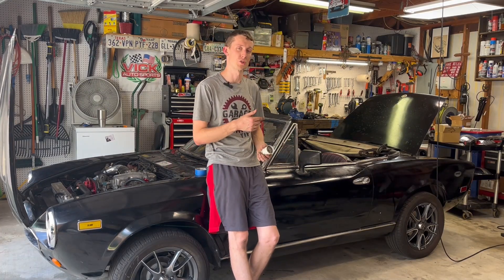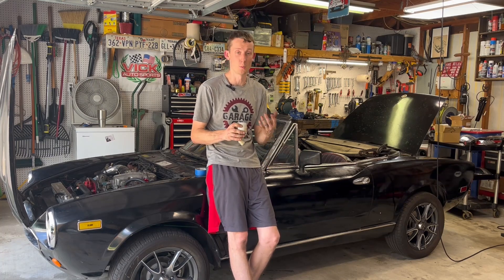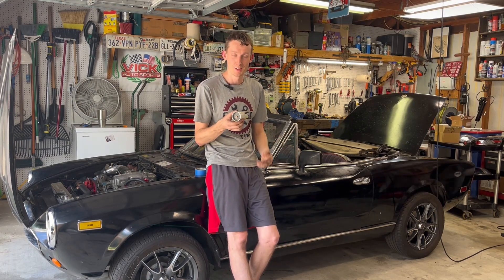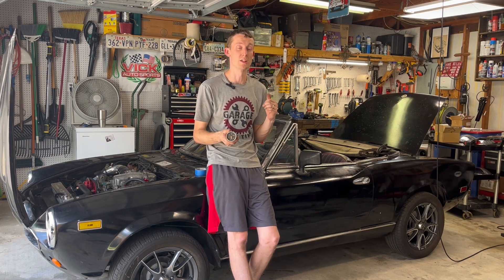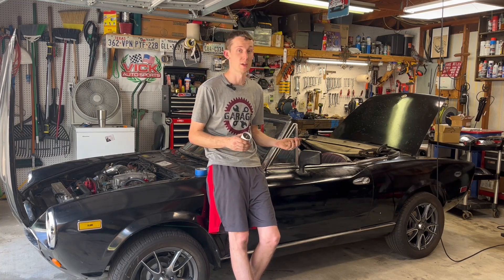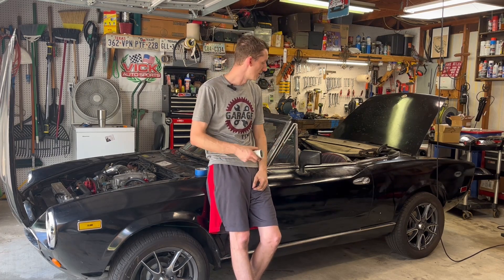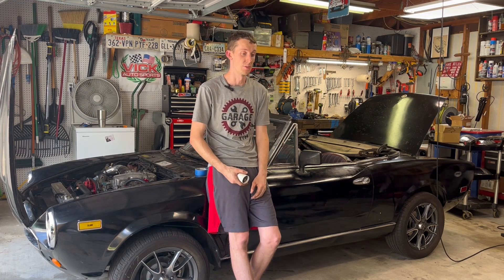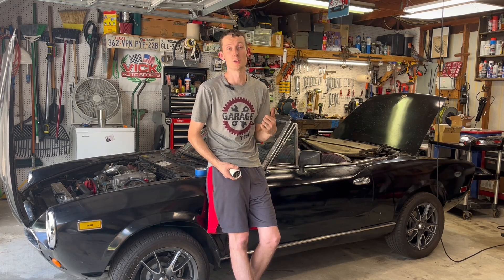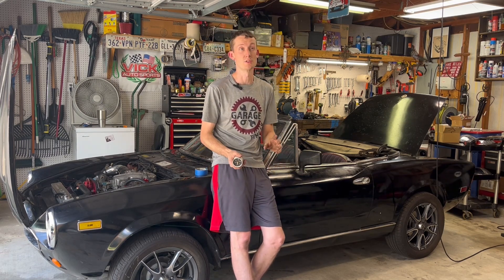That's just how easy it is to put an oil pressure gauge in instead of this junky old clock. Sure, I could rebuild the clock and get the glass and the bezel and get it working, but it didn't provide anything useful for us. Now we have a really good gauge on how to measure the health of our engine, especially after a rebuild. It's so much better than just a dummy light, and now we can actually see what we've got. It wasn't very hard — it took some time running that wire up through the firewall, feeding it through, and just matching wires to wires and giving it a good test. The gauge matches really, really well. Like it really fits in, even though it didn't come with it, which is really nice — making it look more original, but not original at the same time.